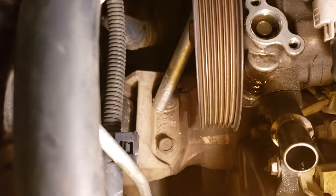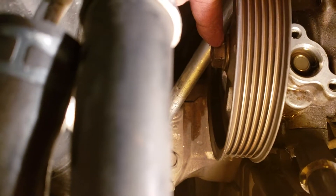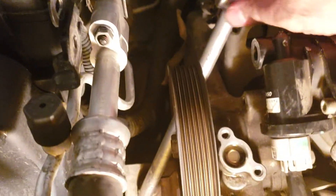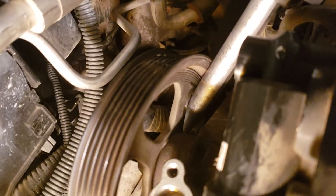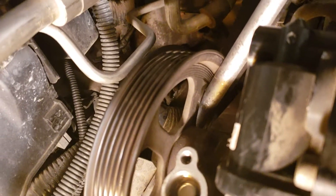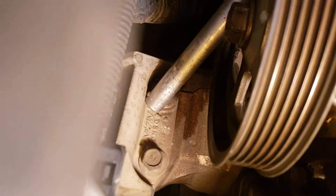So the only way to take that bolt out is to take out the pulley. Some people leave the serpentine belt on and loosen the bolt right here, but sometimes it will spin and just not hold. So I put a breaker bar and jam it in there — this is just a quick tip — put it into that groove inside the pulley and then rest it on the mounts.